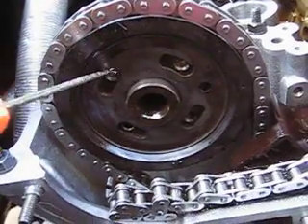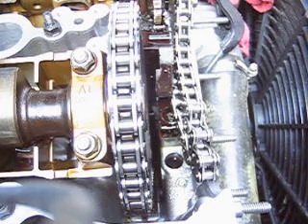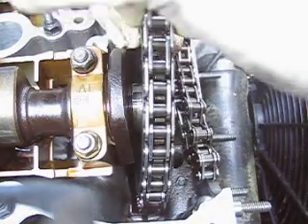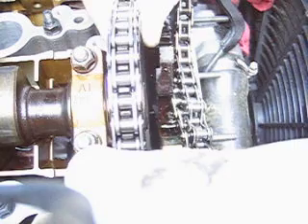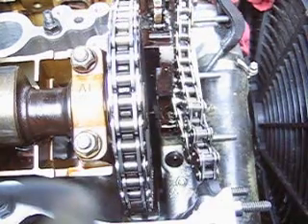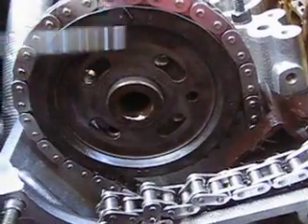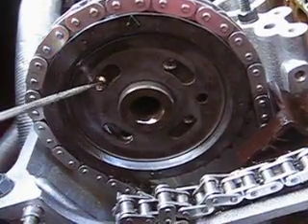Unfortunately, this has ended up with the threaded holes biased to the right. You do not need to remove the entire sprocket just to make a small adjustment. You can simply pull it off of the hub and slowly move the chain one link at a time over the top of the sprocket, and also move it slightly to the left or right, allowing you to get it into the position that you want. With that slight adjustment, the arrows are now pointing even more than before, and the threaded holes are now biased properly to the left of the slots in the sprocket.